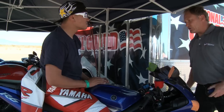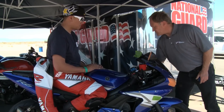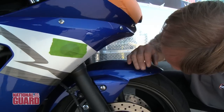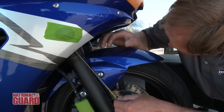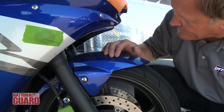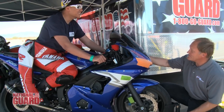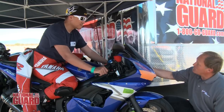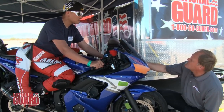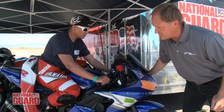Now while you're on the bike, I'm going to measure sag and see where you're at. You have no preload in the front end at all — let's see what we have. Right now you're only using half your travel that's available to you, but the sag is actually correct, so I'm guessing this has been re-sprung. Bonus for you — this has been reworked. It's got much stiffer springs up front. You're using just over half your travel, occasionally going to two-thirds with a hard braking drill. I'm going to add a little bit of preload, but not much at all. Let's measure the back of the bike.